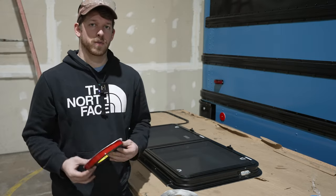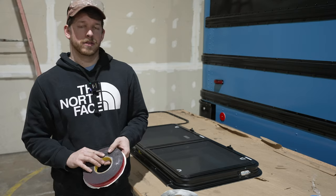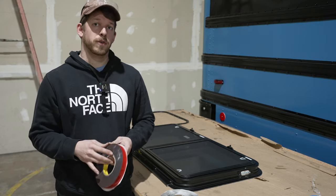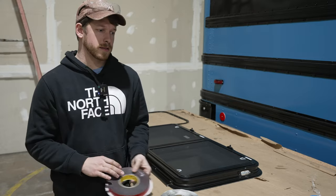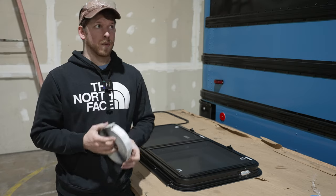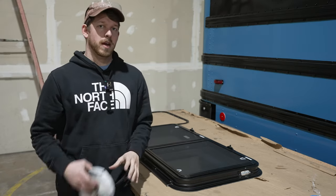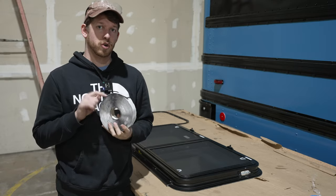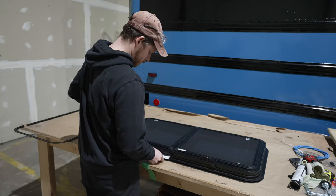Some manufacturers recommend using foam back tape when replacing an RV window. And in that circumstance, that's the thing to do if you have an RV and you're just replacing your window, follow your manufacturer's guidelines. Butyl tape's thicker and it squishes more, and we like that with our sheet metal sides. They might not be a perfect surface to mount to, and having something that's thicker and squishier, it will more likely keep water out. So we're sticking with butyl tape.